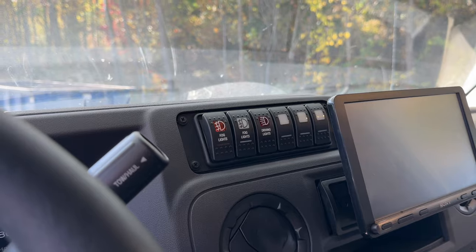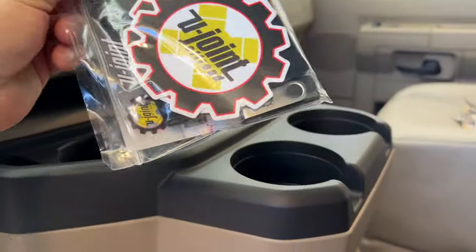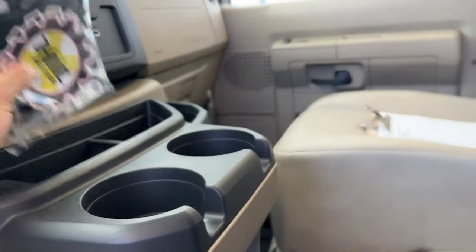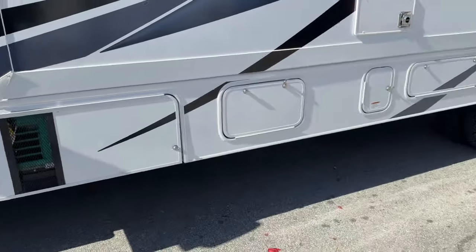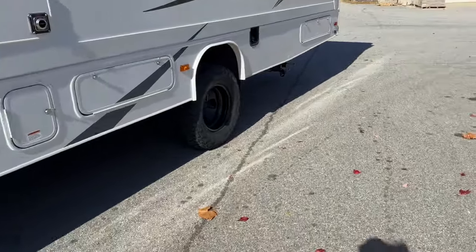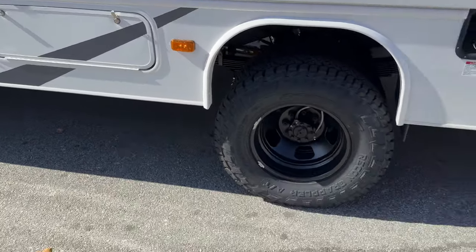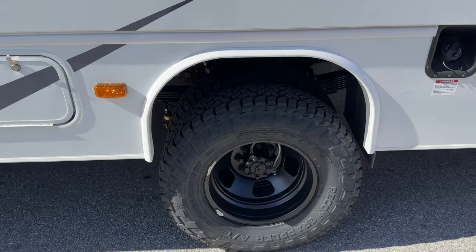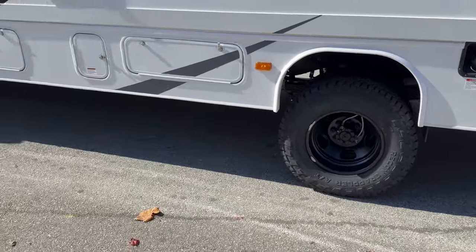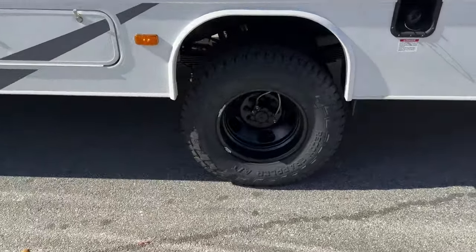They've got three open circuits so they can add more lights or accessories. Here's a little goodie bag we give with all of our conversions, and a USB drive. The USB drive has all the information they're going to need in the future for servicing this thing — what we recommend for service intervals, a list of all of our part numbers for everything we do, so everything from brake pads, bearings, seals — everything in the front end is listed out with part numbers to save on confusion. T-case warranty's on there too. Lots of good information about the rig.